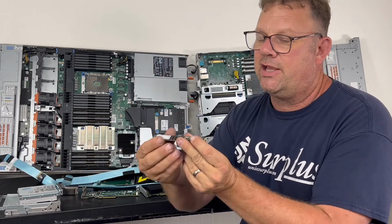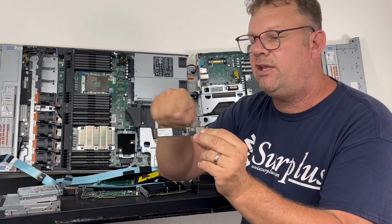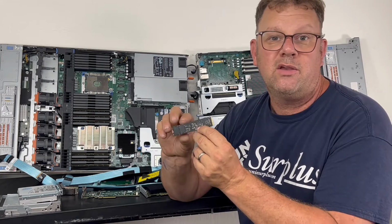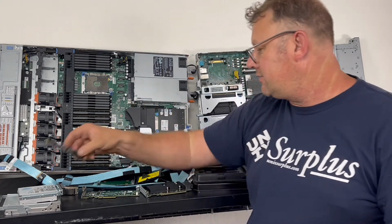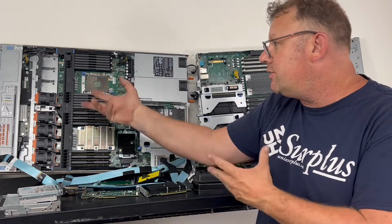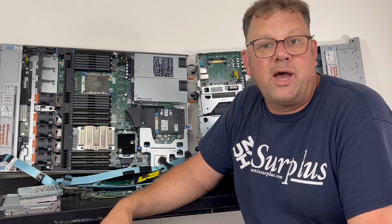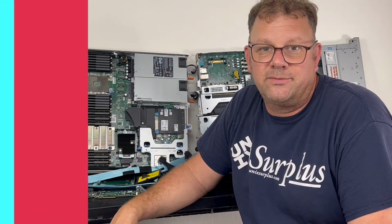What this does is allow you to have a memory cache with a controller and enough power on it to complete any write that's still waiting, just like you did with a disk drive, similar to the reasons you would have with your RAID controller having batteries. So these are the new formats that are coming out, and we'll discuss those a little bit later about M.2 and U.2 disk drives.